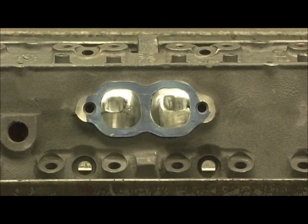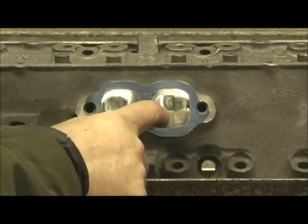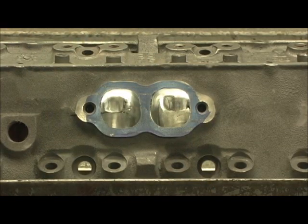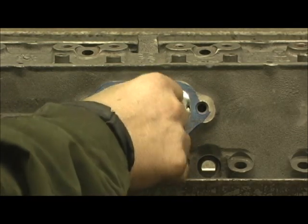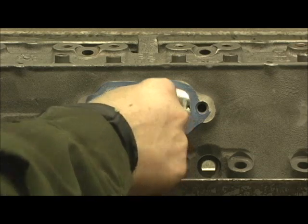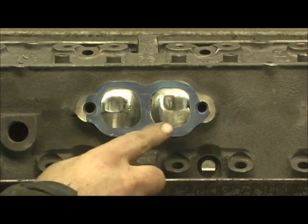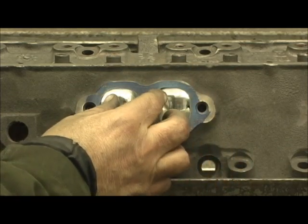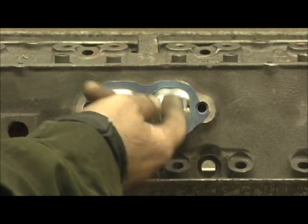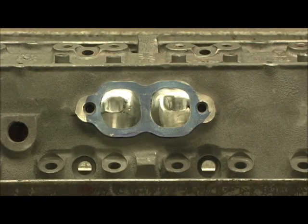It's a good mix because you really couldn't do much more in here. I got to give credit to the guy that did it before — he did all the hard work. They were a little bumpy; I straightened them the best I could and smoothed them, but I couldn't go outside the diameter because it's putting the horns on. With that gasket, if I went bigger I'd of course have a big wall — I'd be hitting the wall of the ram horns as it comes out.